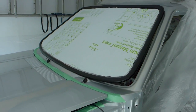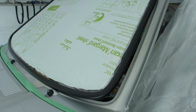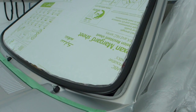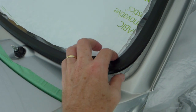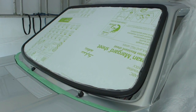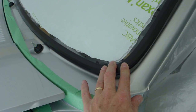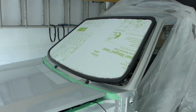The Marguard lexan sheets — I've got all the windows stacked inside here. We ended up not coating them with 3M Crystalline because the head rep said it grabs really hard, doesn't let you position it well, and he thinks it would lift. So what I've done is trimmed the edge and put the molding in, giving myself a starting point to install it. It bends nicely into the corner so I think it'll hold fine. I'm about to soap it, put the rope on it, and install it.